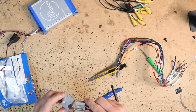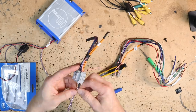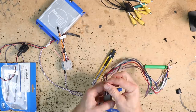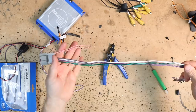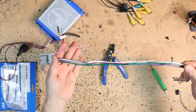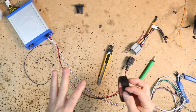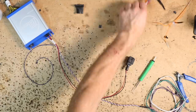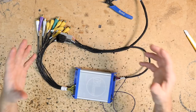Removing the female end, plug it into place. There's a pink and a pink-black wire. The pink is going to the white wire, and the pink-black is going to the purple wire. I'm going to solder those on. The extra wires — the blue, brown, and red — we're not going to be using. I want to remove those off of the harness. The shrink wrap is off — these are the pins I was talking about, so if you're good at soldering, you could definitely solder on. The last thing I'm doing to this harness is adding a layer of tape, just like the factory. Our Zen is prepped — we have our speaker wires, remote turn-on, and RCAs. This is ready to get into the car.